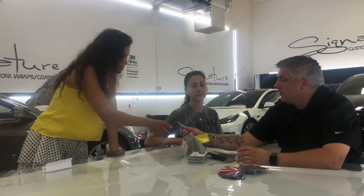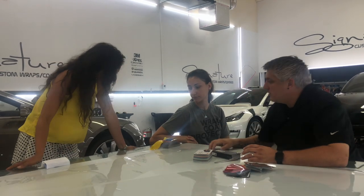If you have a car that already has damage — chips, swirl marks, light minor scratches — that can all get polished out before wrapping. But if there's surface-visible damage like a rock chip, because the vinyl is very thin material, you'll see the chip through it depending on what color you put on. You can guide somebody by telling them it'll get a new look. We have a client that gets his car wrapped every year so he won't buy a new car, and a wife who gets it done every two years because it's like getting a new lease — same car, but she feels like it's brand new.